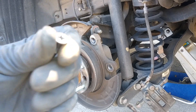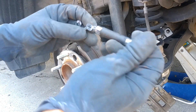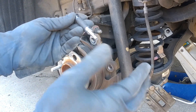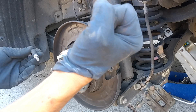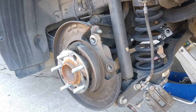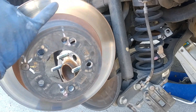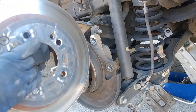If you're having trouble taking off these screws, get your screwdriver and tap on the back piece with a hammer. Hold it firmly and try loosening it at the same time — it might loosen at that moment. If not, at least you're breaking up whatever debris is inside. You can also tap on the drum itself on these spots right here and on the opposite side with the hammer to help break it free.